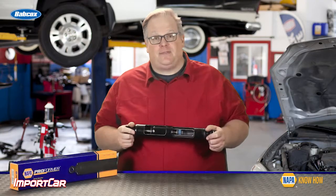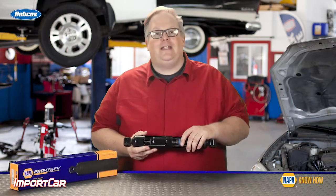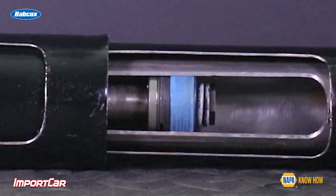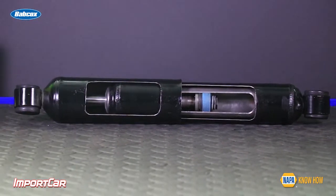This may seem like a simple device, but actually inside it has a lot of elements to help control weight transfer. The piston itself has separate valves typically for compression and rebound — when it compresses, it has different valving, and when it extends, it has another different valving. This helps to control the vehicle and is often very specific to the platform the shock or strut is being used on.